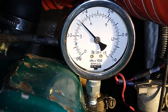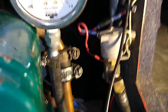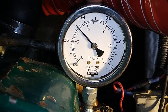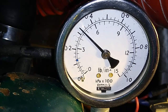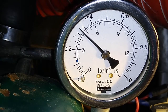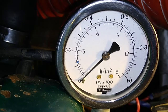What we're going to do now is drop the power off the pump and open up the solenoid, and you will see it backflow the fuel — confirming that Facet pumps do free flow when they're not running. If I release that solenoid lock-off, you'll see the gauge drop in pressure as the fuel backflows back through the little fuel pump to the tank.